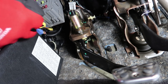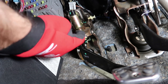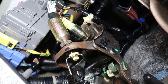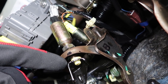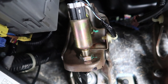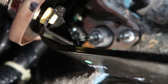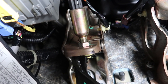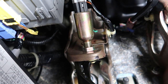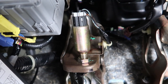You're going to want to look underneath this part and see how many threads are actually showing on the bottom side of this adjustment screw. For the stock CMC stock clutch, you're going to want to go to one thread showing on the bottom and then lock this down. For an aftermarket clutch — Action Clutch, Clutch Masters, Competition Clutch, ACT — you're going to want to go to about a quarter or a half thread showing on the bottom. That will actually increase the release travel. For heavy duty clutches you want more release travel, and for the stock clutch you actually want more release travel too — more than they give you from the factory. That'll help with your clutch disengagement problems.